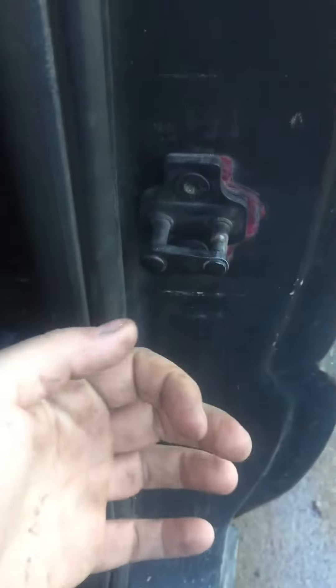There's a piece behind it — don't let it fall down, just grab it. Then you just screw it back in and everything, and it'll tighten your door right up. You do the same thing on that side, except you don't need to take that panel off because you can just use this service cover for the car jack.